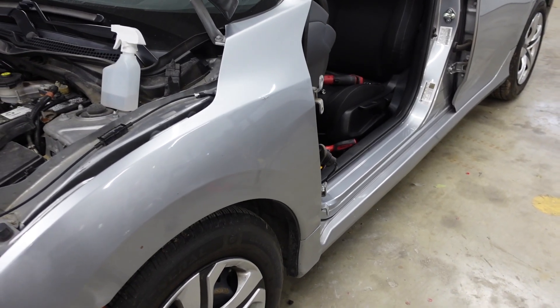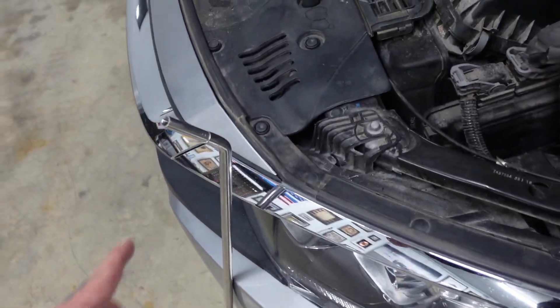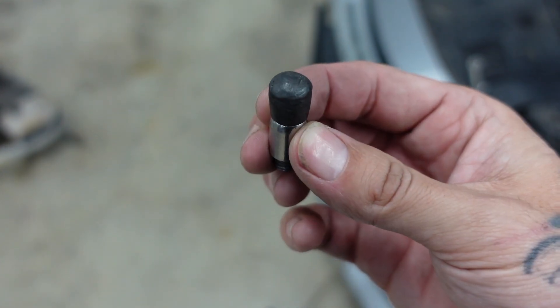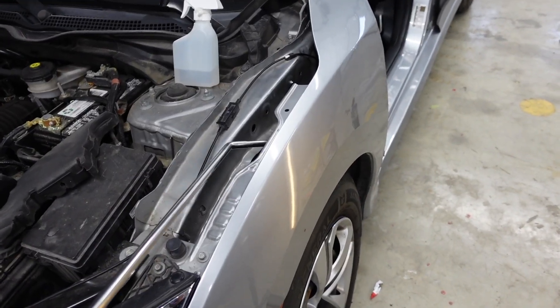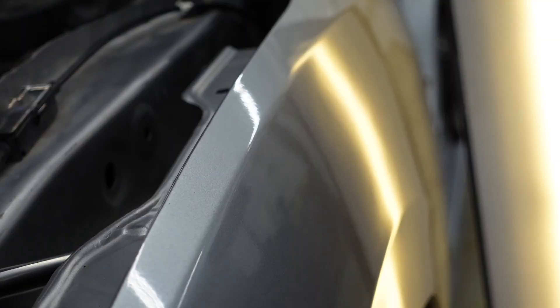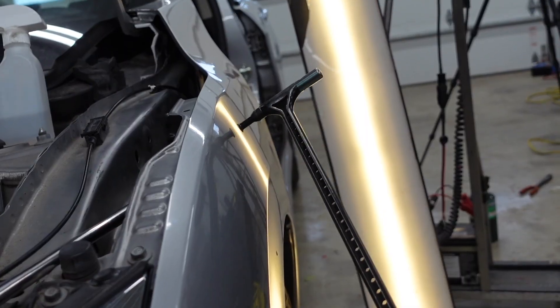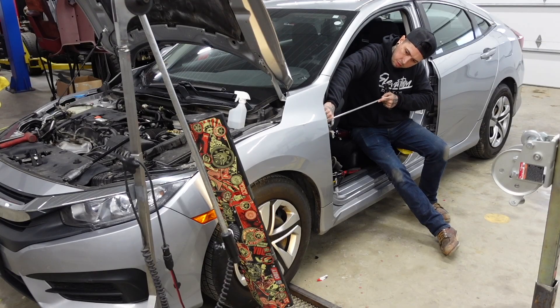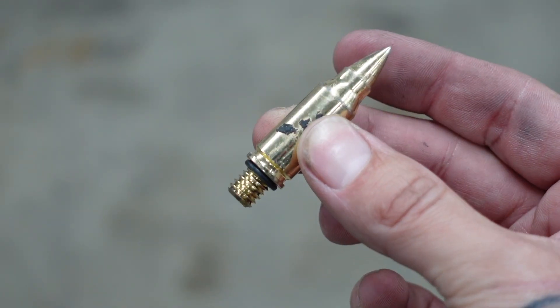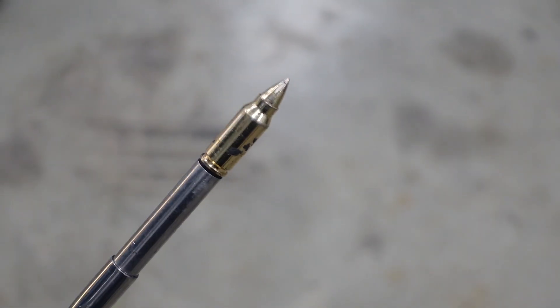I got a really large portion of this metal pulled out, but it's nowhere near finished. Now it's time to get off the glue and get on some PDR tools. I'm going to start off with this Ultra Dent tool with a small extension and a blunt soft tip. I'll slide it up in the inner fender and work out all the waves and low spots with the soft tip, then move on to a sharper tip. Now I'm switching up to an insanely sharp razor tip using that same interchangeable tool — this tip is going to do all the finishing detail work.